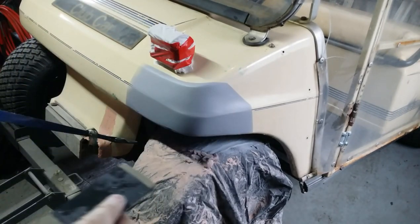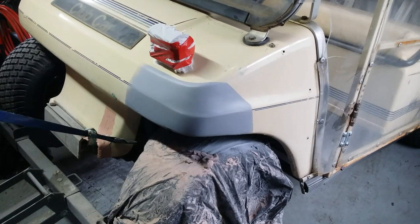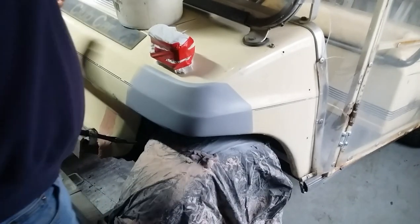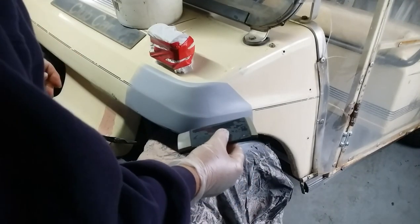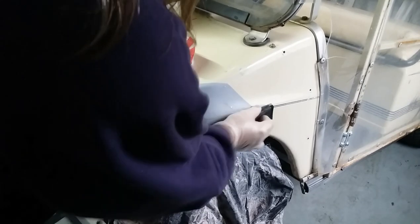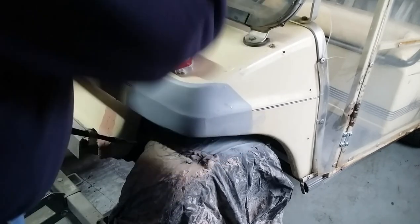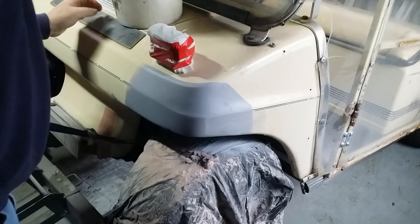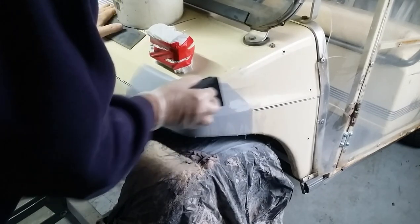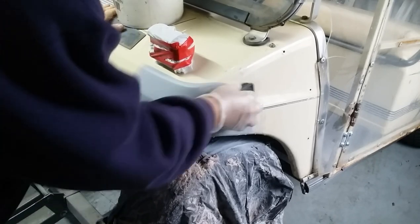So I have soaked a piece of 500 grit wet and dry sandpaper. We are going to sand this primer down. I put about 3 good coats on it yesterday. So it's had a significant amount of time, like 20 hours to dry. Wet sanding this down is hopefully going to take the imperfections and tops off, and maybe fill a few scratches and sanding marks.